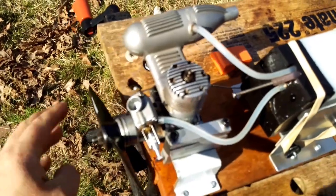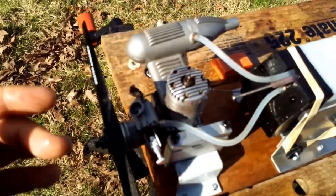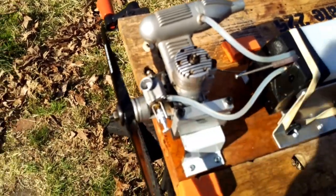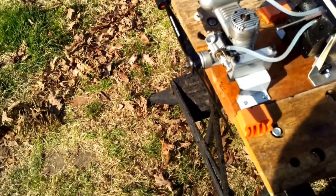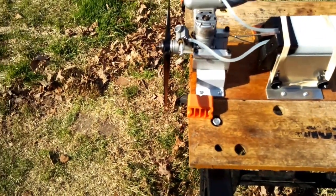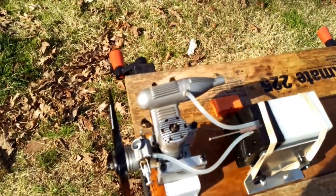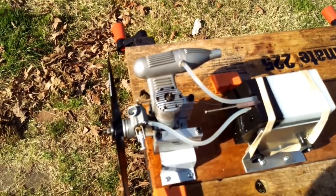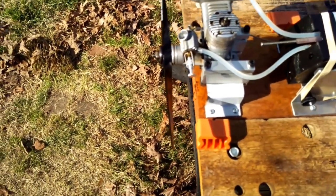Feel that. And that's not on a cold engine where people like to test compression. That's hot, right at 175 degrees. It's cooling down quickly. But yeah, so I'm gonna try to just do a peak speed test. I don't think it's near broken in yet, just because of the way it's holding a needle setting. You set it just barely, so it's four-stroking, and it breaks into two-stroke and wants to take off. So I think it needs some more time.